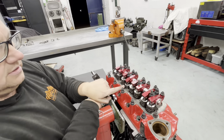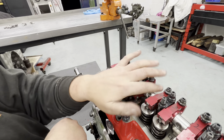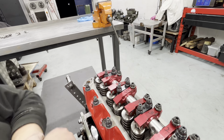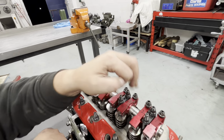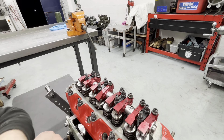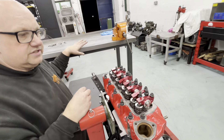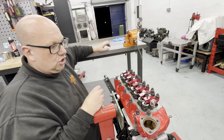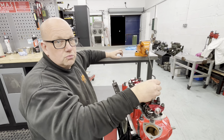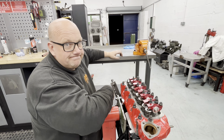So as you can see now, rocker number five is all the way down, we've got clearance on the centre spacer and obviously now we've got clearance on the rockers. I've just gone around and checked all of them and they're all exactly the same clearance, so nothing there now is going to bind up. You might find it's in the fitting instructions for these rockers — I don't know, I haven't looked — but just be aware, it's another one of those 'don't just fit things as they come out of the box' situations, as it can cause you problems.